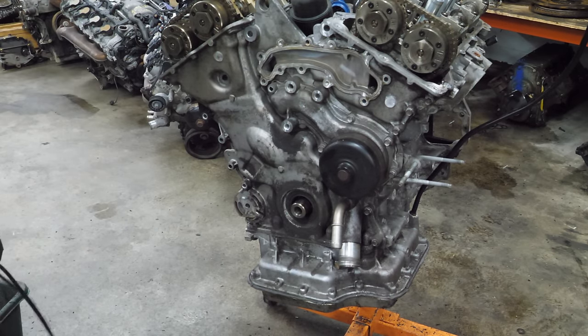Now I've got a few 13 millimeters that hold the timing cover to the upper oil pan. This timing cover should come right off. Do what you got to do. Now look how clean that is in there — it is not often that we pull an engine apart that's this clean. Everything inside the timing cover looks pretty tidy. Everything's clean and nice. I don't see any broken pieces and there's no signs that anything's coming apart.